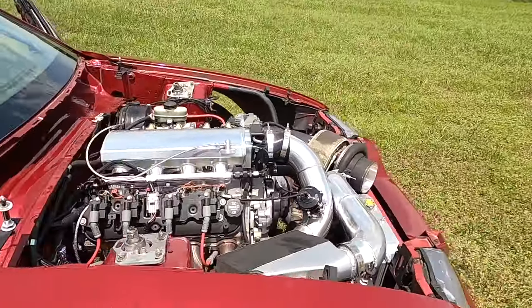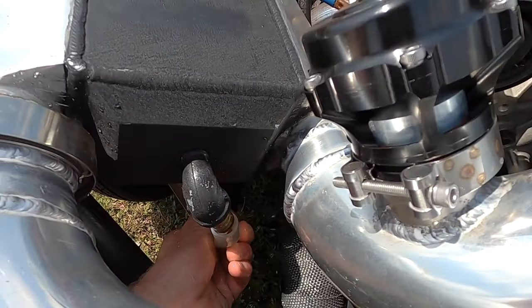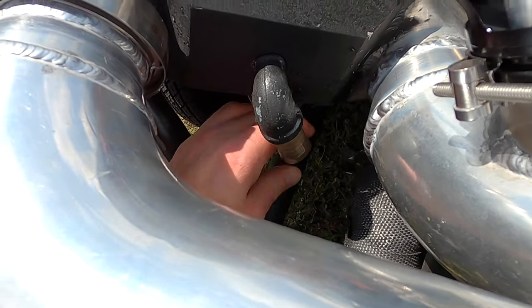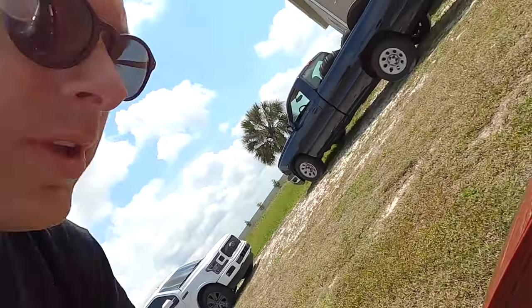Oh, here's the intercooler lines that I'm going to be replacing. It's kind of just like this 1-inch fuel line. It just has water in it, but it easily comes off, and I don't want that to come off when I'm doing a pass or driving down the road, and then water sprays under the car, and who knows what could happen after that. So the transmission cooling lines and the intercooler lines need to be replaced, and that's nothing against Les. They just, for what I'm going to be using the car for, I want to have stuff that I know is going to be really reliable since we're driving it a lot of miles.